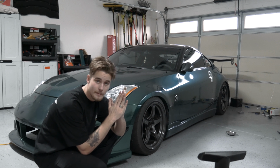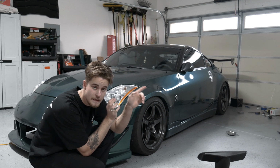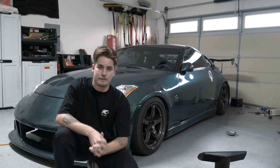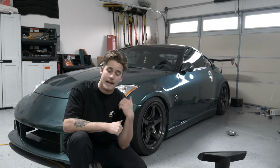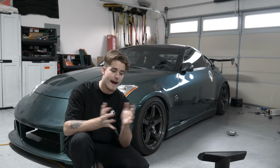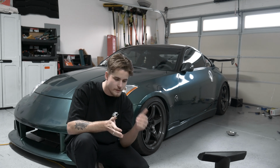What I'm gonna start off with is I'm gonna eat, then I'm gonna come back out and get those brackets off the OEM bumper like I said, pull the VIS racing bumper off, and then transfer those brackets over, and hopefully we can get a really good fit with those guys on there. I am just gonna drill out those rivets and then pull some new ones on the fiberglass, because I really want this thing to fit good, and I'm having issues with this driver's side where it just won't stay tucked.